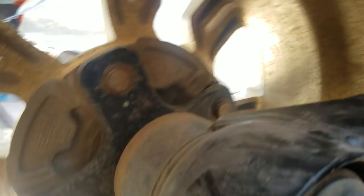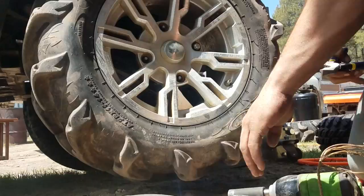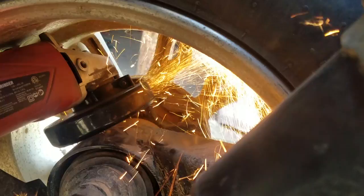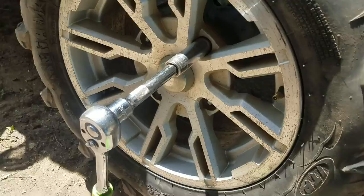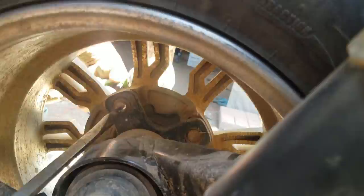The issue is that whenever you're turning this last lug nut, the reason it ain't coming out is because the stud itself is spinning. The very first thing I tried was to hold the back of this spinning stud with some beefy pliers, which didn't work at all. The next thing I tried was to cut a little groove on the back of the stud and hold it still with a big screwdriver. But it was really tight inside this wheel even with the tilt bed up, and I wasn't able to cut a straight or deep enough groove. I'm convinced someone with a little more skill and a steadier hand could get it out that way.